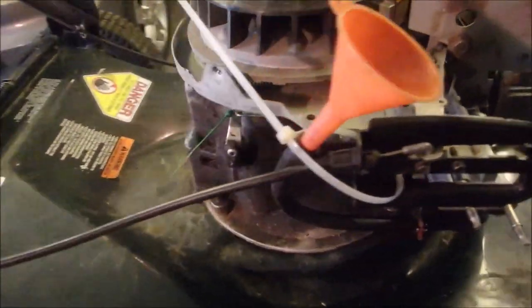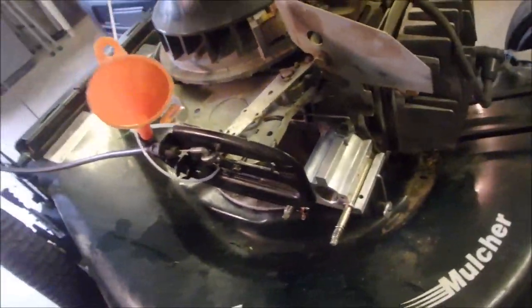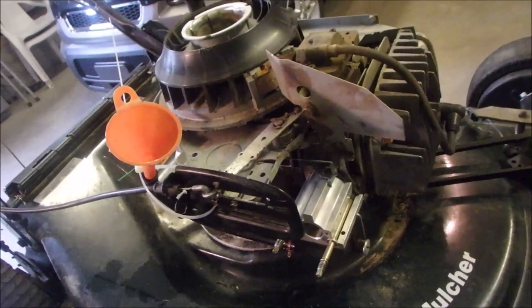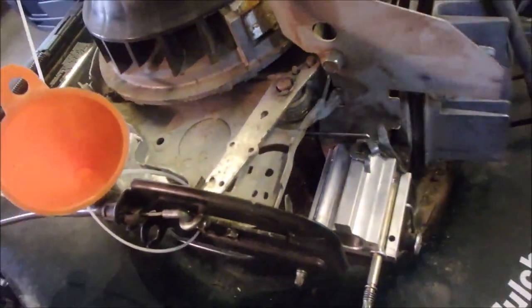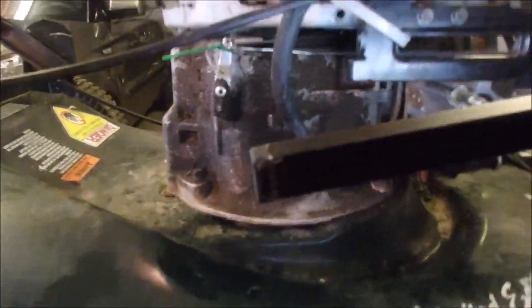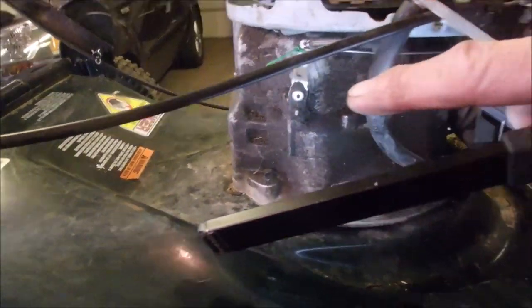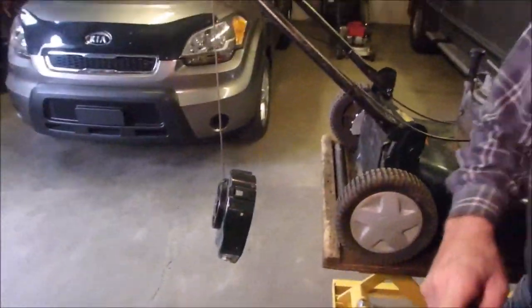Okay, that's pretty darn good for a first guess, eh? I mean, the length of that governor rod was just a swag, a scientific wild guess. And I can control it by that spring right there. If you can see that spring right there above there, I'm going to tighten that up and we're going to give it another shot.